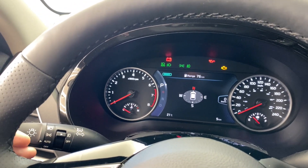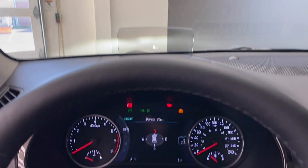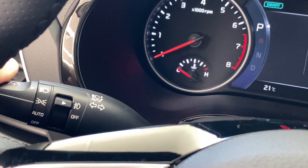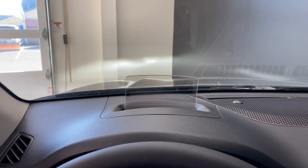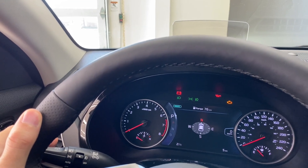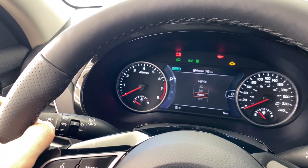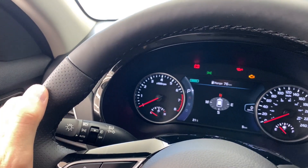To turn them off: leave it in the auto setting, push the lever away, and then immediately pull it back — yes, that does flash your high beams but it does not turn your rear lights off. Now if you just don't want the auto high beams at all, it's very simple — just turn this lever all the way to the regular headlights. When you're on regular headlights instead of the auto setting, it just works like normal: push away from you and it's on, pull towards you and it's off. So if you want the auto high beams, leave it in the auto setting and push it away; if you want to cancel it, push away then pull towards you.